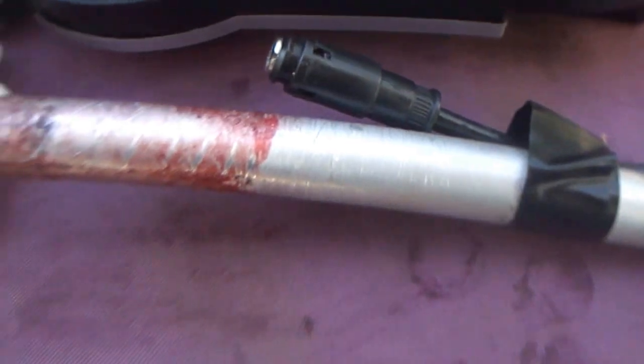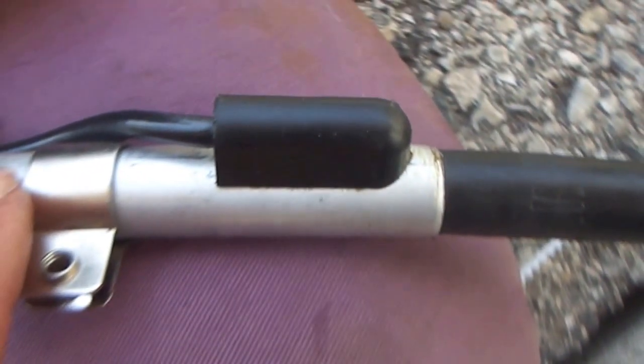Now when you've got this puppy out here, the next thing obviously when you replace the antenna mast is there may be a case where the antenna mast is actually broken. So just make sure you've got the old one out and any pieces of the antenna band. You can see this is the old one here that I've taken out, and there's actually a clip here that sits on the inside. I'm pretty certain that in a lot of cases this thing is going to get corroded in here, but you really need to get it out.